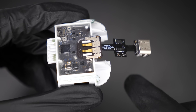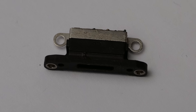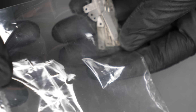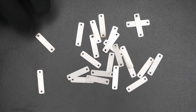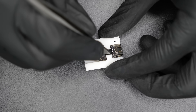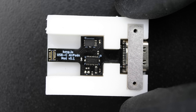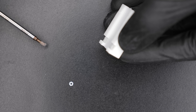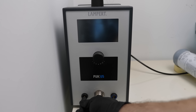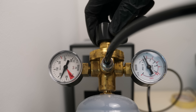The custom replacement part is just flopping around and I need a way to fix it in place. I want to level up the quality of my work, so I looked at what Apple was doing with their connectors — metal supports. Interesting. So I designed and ordered those parts that were laser cut in Spain. I found that the AirPods use 1.2 millimeter screws, so I ordered precision 1.2 millimeter nuts. To secure all the pieces together, I used a 3D-printed guide. I got my hands on the best tool for the job — a precision puck welding machine from Lampert. It uses argon gas and high current to make very fine welding spots.